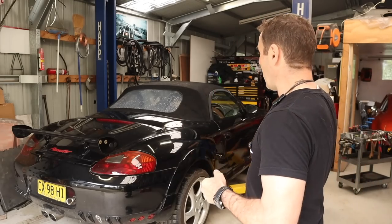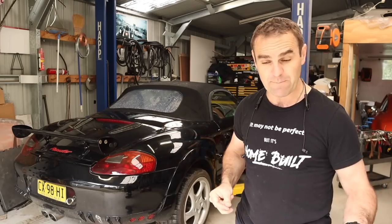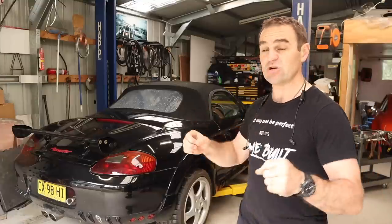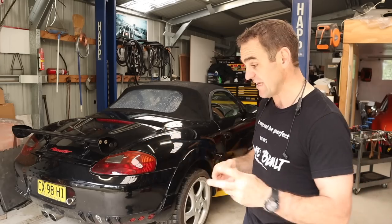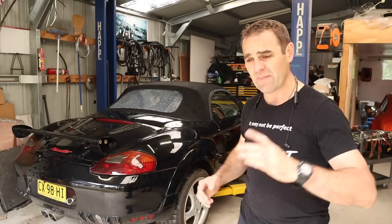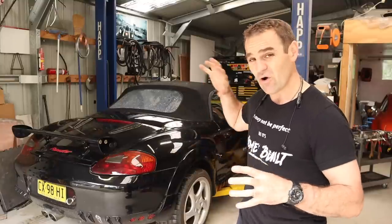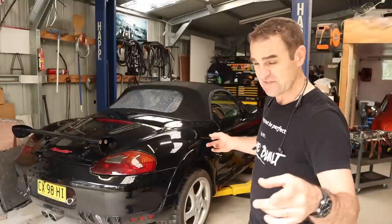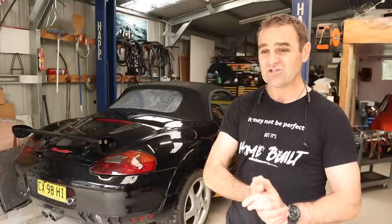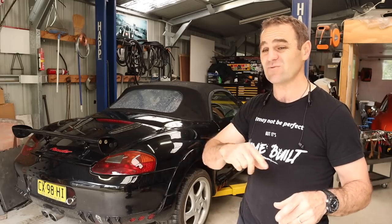In the meantime I've also been messing around with different fan belt sizes. The fan belt I had before kept slipping, as many of you will have seen in previous episodes — it was just too big. I had to try about four different custom sizes to get it to fit because it's a very tight fit. I finally got one that has some tension on it, so that should fix the fan belt slipping issue. Now I've got the new belt in there, it's time to button this all back up and connect it all. I've also previously put in the oil accumulator, which has to be set up for the first time — so there's a bit of stuff to do.